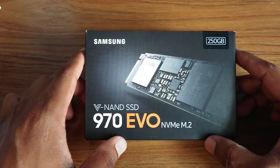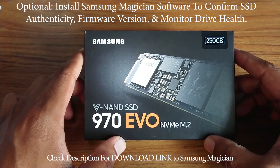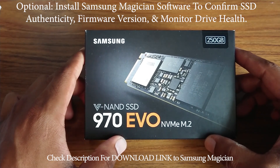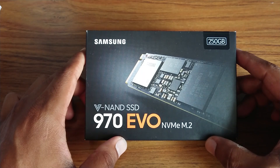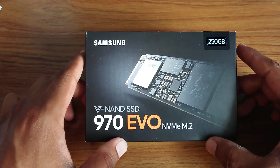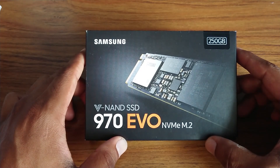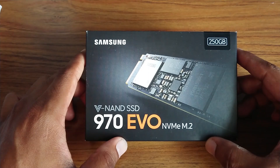...if you use the Samsung Magician software — which is what they recommend for their SSDs to check if it's genuine, monitor drive health, optimize it, and check for firmware — the software will say it doesn't recognize the drive. So make sure AHCI mode is enabled before you install it. After installing in AHCI mode, the software does show it's a genuine Samsung product, health is good, and it's on the latest firmware.